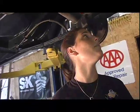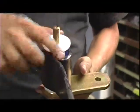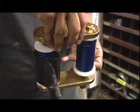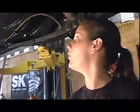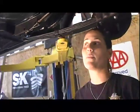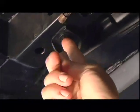We did install some Detroit Speed 3-inch drop leaf springs and some new Del-A-Lum bushings from Global West and the shackles. So in the process of that, we realized that when we took the old ones out, we actually broke some of the clips that hold in this front leaf spring bracket. Upon assembly, we couldn't find any clips like them at all. The problem was the depth, that they needed to go in from the frame rail to go into this hole.